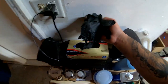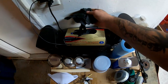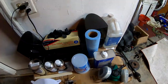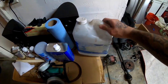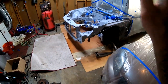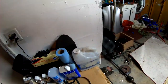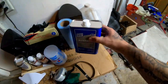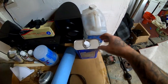Next on the list are gloves. Make sure you have gloves, otherwise you'll end up with paint stuck all over your hand. Get yourself some paper towels for cleanup, and don't forget to get a tack cloth — you might need that later on. I have mineral spirits because I like to use them to clean the surface before I lay any paint, wiping everything down one final time before hitting it with the tack cloth.